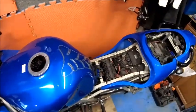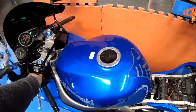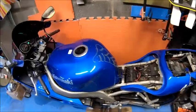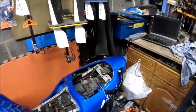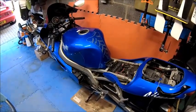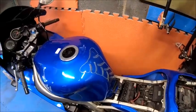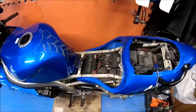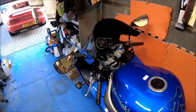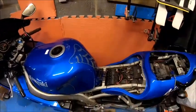We've got lights. Stick the choke on — moment of truth. Oh my god. That was completely and utterly unexpected. So if you've got a gel battery and you're getting 12 volts but no amperage, top it up with distilled water, charge it overnight, jobs are good. I am absolutely speechless. Makes me want to cancel the new battery order. Wow, incredible!